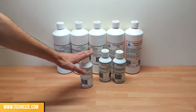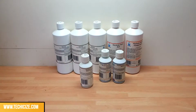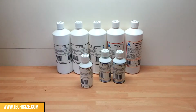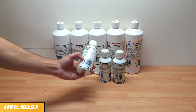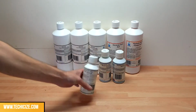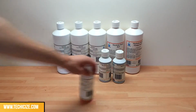but there's much more colour choice for ready to buy and ready to use in the Mayhem's X1, compared to the XT1, which is just available in a small number of colours. So this one's probably a more logical choice for the majority. It's 250ml. For every 125 you use, you're going to be able to produce 1 litre. Of course, it's 100% compatible with the dyes. You can buy it as a ready-to-use type of product, or you can dye it.